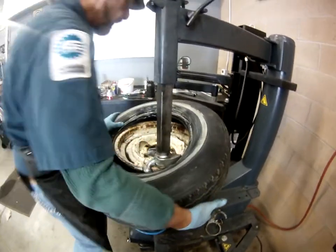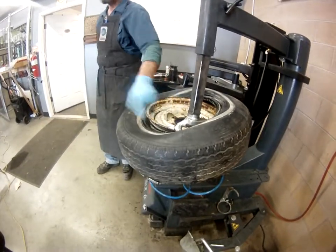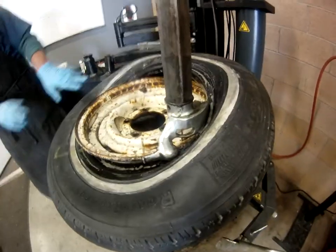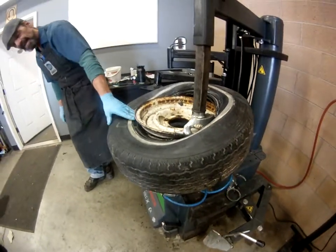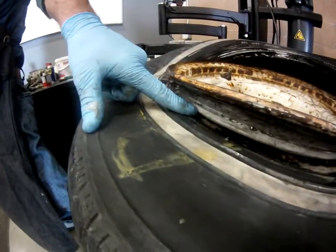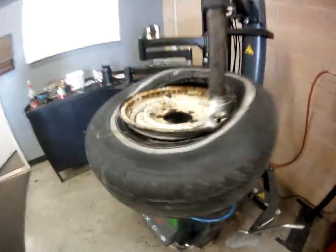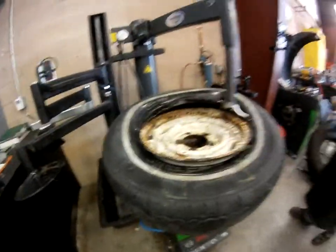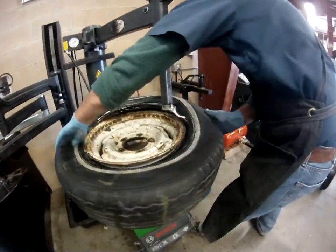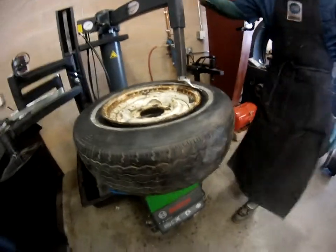Watch this. Slide it down. Duck head is still visible and I still got the shoe back here intact — it almost stays there by itself. We've got the bead dropped right into the center section. Now I'm going to go ahead and put it on. Generally, you're going to have your left hand here pushing this on like this, and your tire gets plopped right on.